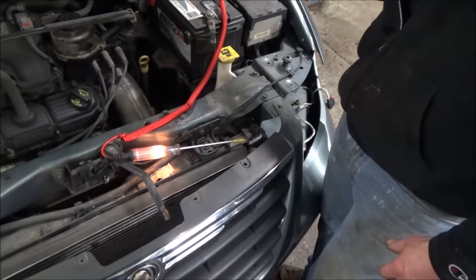As you can see, you kind of have to pull the grill back. I'll set the camera down and do that, then grab the new one I already ordered and get that put on. She has an aluminum rivet so it does come off. They've got a little plastic guide pin on them. Let's knock the rest of that rivet down. We're going to get nasty with it — give it a little hammer. Use your favorite punch slash screwdriver.